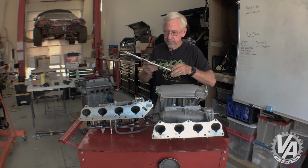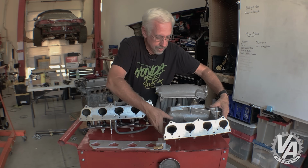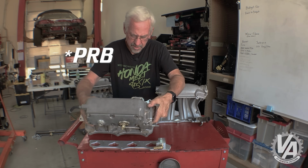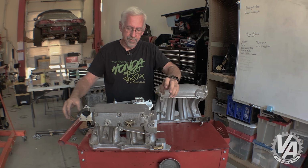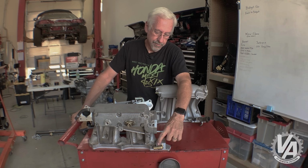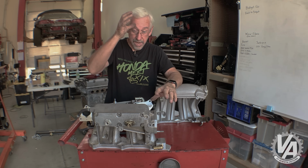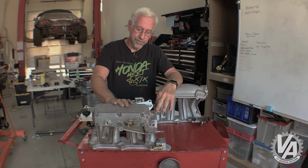Hasport makes this handy little adapter plate that you would use to sandwich in between your RBC manifold and the head of your 06 Civic Si. Now we have a place to mount the air assist valve. We have the recirculation hose for the head that comes off the bottom of the plate, and we can still have the nice compact intake manifold that has a lower profile so that we can get it on our CRX.